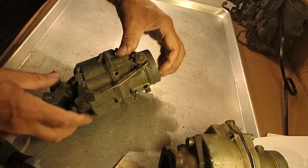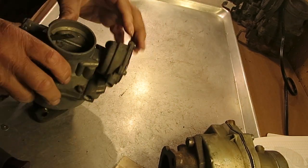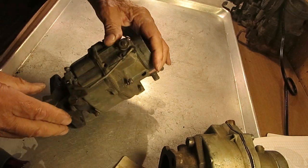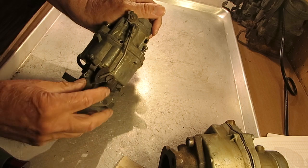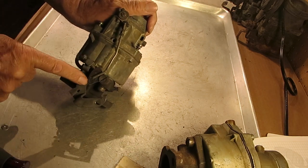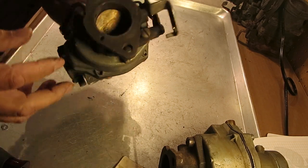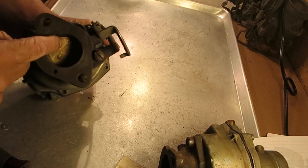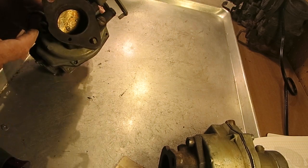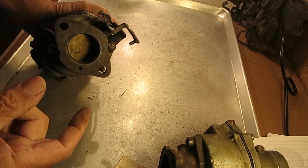The later one has a hot air choke on it that opens and closes the choke. When it's open, you can see the fast idle cam is down here at its lowest point, and down here is the high point. Here's your idle screw again. We'll look at the throttle valve — it's completely closed. Again, if you're idling too fast, check and see if this is open; maybe it was put on backwards.